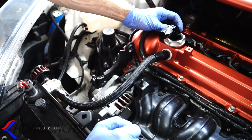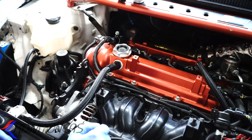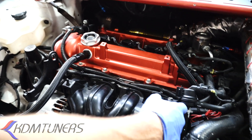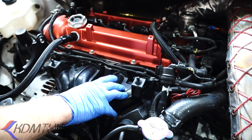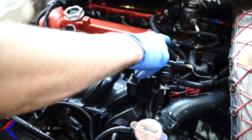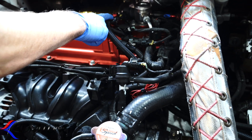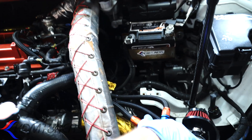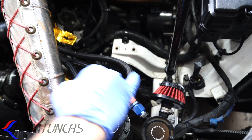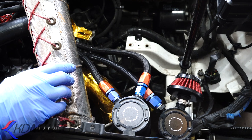The third option is a little more intensive but the benefits are a lot better — what we call an exhaust-side PCV basically. What we do is cap off the line going into the intake manifold itself, so that's completely sealed off. No oil is getting back into the intake manifold, only air. So we have no oil going in here, no blow-by gases being burnt off at all. Then we vent this side: we run a hose off this port and those lines go over to a vented three-port can — two in-lines and one vented out with a filter. The bigger the can and filter, the better.